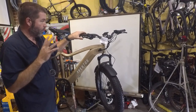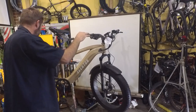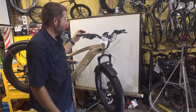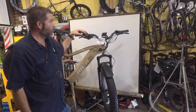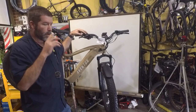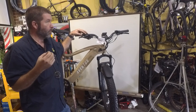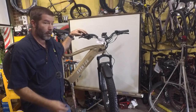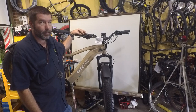The biggest thing we need to do is this bike has no brakes whatsoever. You spin the wheel and it just goes all the way to the handlebar and doesn't stop. These are the Zoom brakes and I was trying to do some research — there's not a lot of videos out there on these brakes. Everything I can tell, these are mineral fluid brakes, so not DOT — it's mineral oil. We're going to be using a Shimano brake fluid or Shimano-compatible brake fluid and showing a step-by-step on how to bleed this.